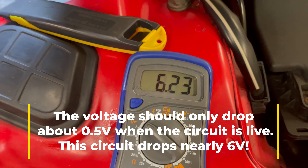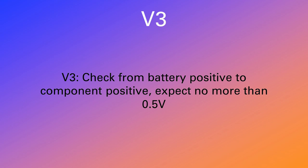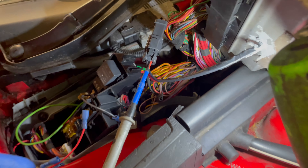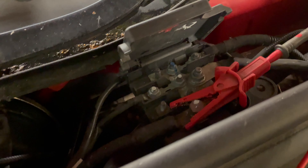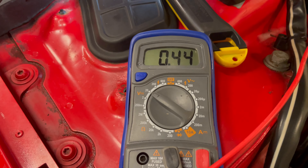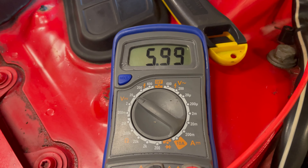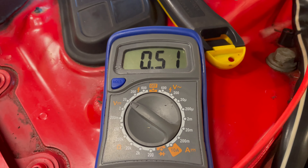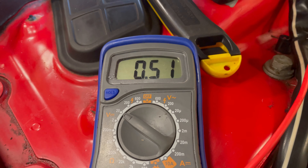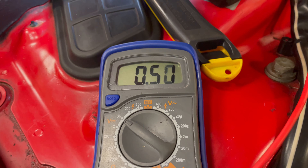It's all the way down to four volts. Step three: component positive to battery positive. I've got half a volt drop — crank it Dave. Look at that, it's jumping right up there, so we have got a fault on the positive. There should never be any more than about half a volt — maximum one volt drop.